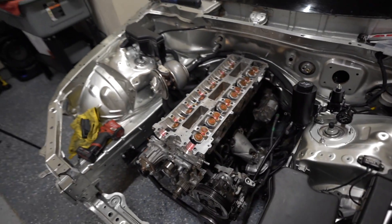Now it's time to finally torque the head. When you remove a head it's outside in — when installing we're going to follow the recommended torque sequence using ARP's recommended torque. The factory spec is around 25 foot-pounds and then some degrees twice. When it comes to ARP, you're going to do 80 divided by 3 and then work your way up to 80 foot-pounds.